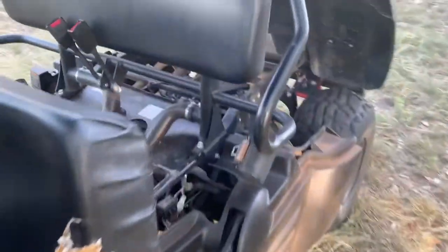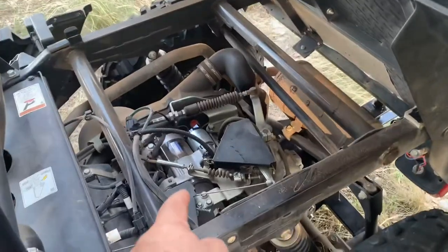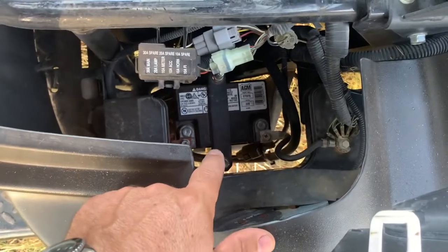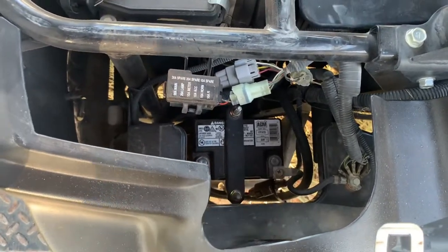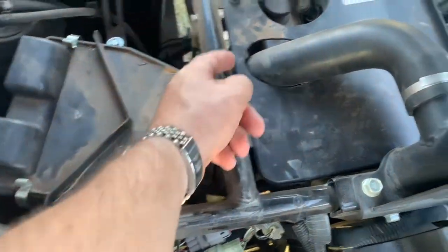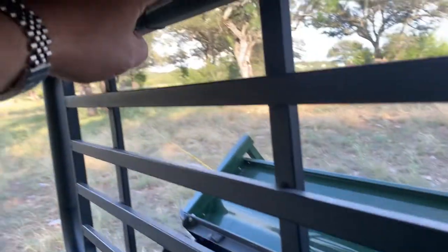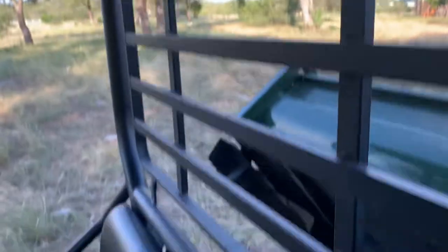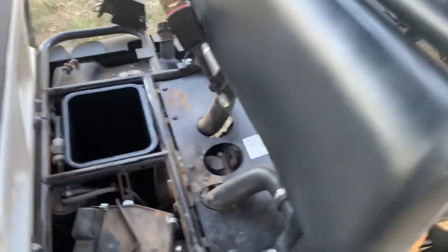There's a very small battery on this thing — it corresponds to a pretty small starter. This is the kind of battery you'd use on a little two-stroke scooter. The air filter is interesting — it draws air in through a hose that goes all the way up the frame and pulls air from higher up, so you get clean air instead of dirty dusty air from down here.